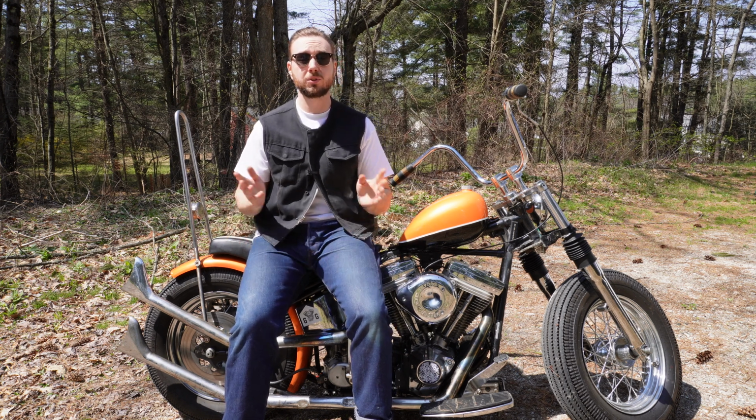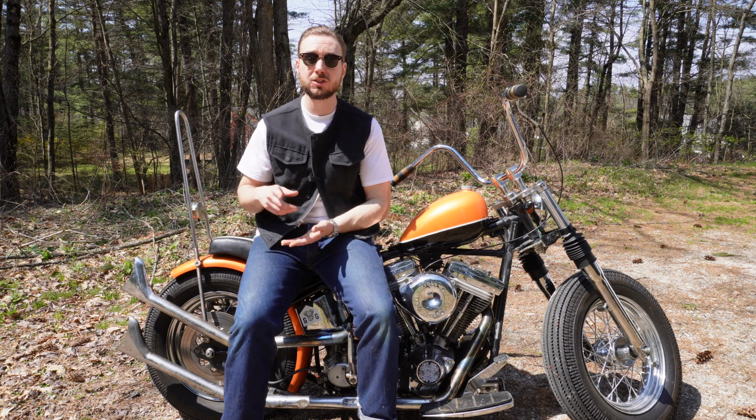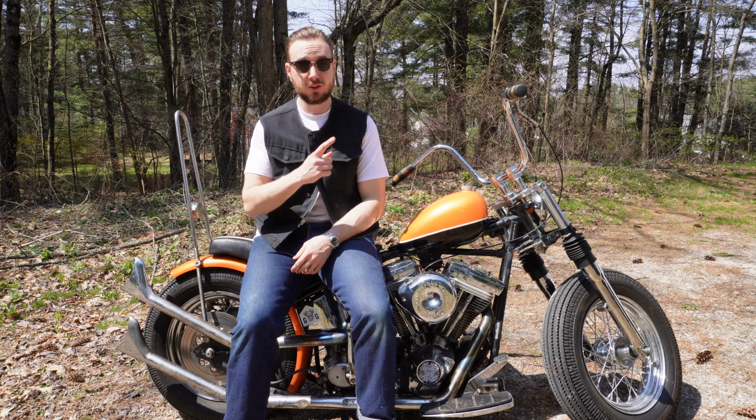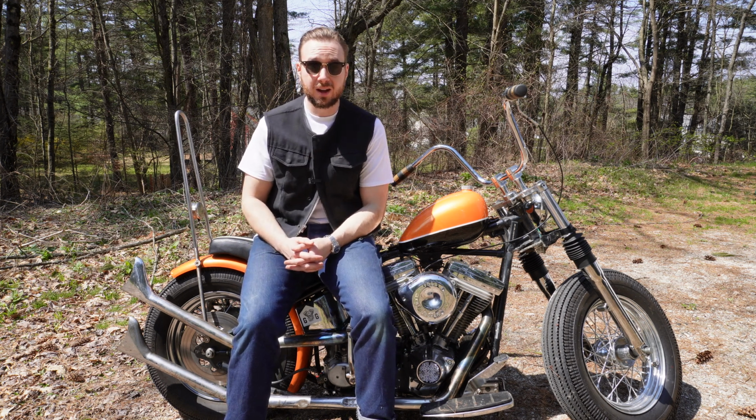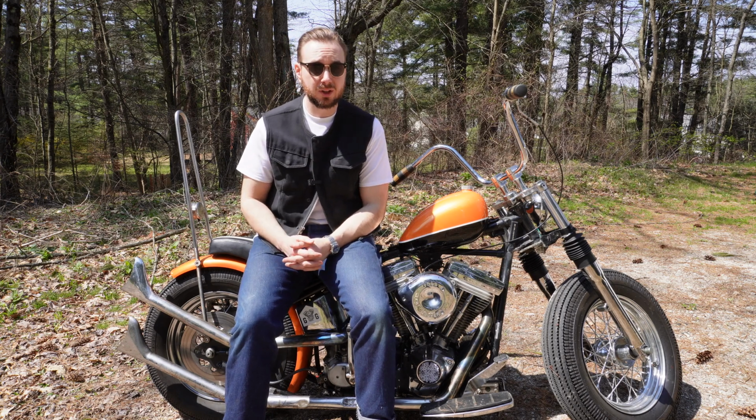So a good practice when the season starts is just to remove your carb from the bike, give it a full clean, spray it out with carb clean, and make sure you check out my full video on opening up the S&S Super E, linked right up there in the corner if you've never done it before.